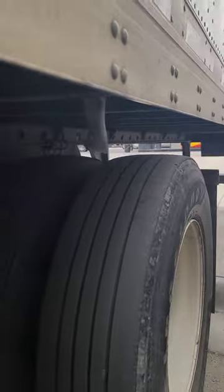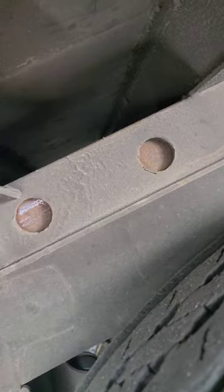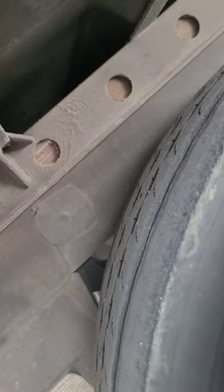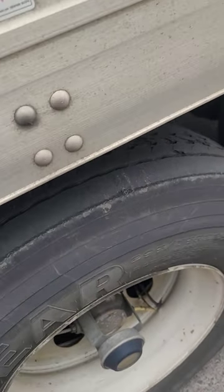Mine are all the way up, but you can slide it all the way to the back. Now there's a space between these holes on this trailer — those denote a 500-pound hole. But on other trailers, they'll have a lot more holes, double the holes, so those would be 250-pound holes. We use those as a guide to figure out how to put our tandems where they need to be. Hopefully that helps out and explains a few things.